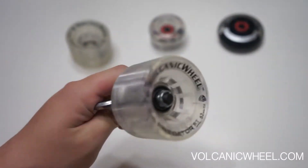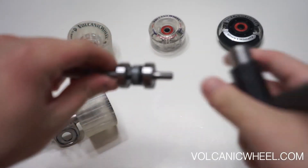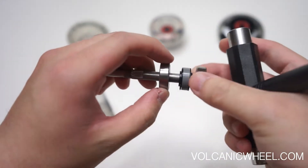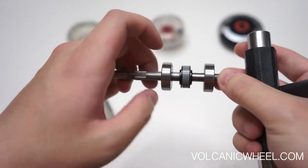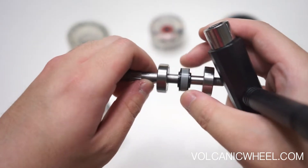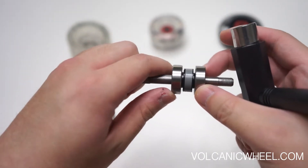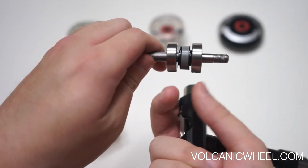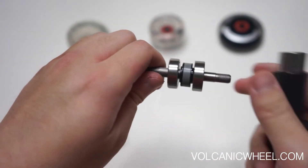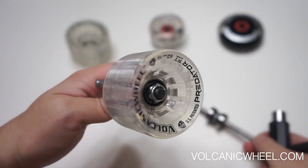But it's important to understand that it's because there's a gap between the outer bearings and the inner magnet. So when the wheel is spinning, this inner magnet should not be spinning. And that can be accomplished by making sure these two bearings are firmly holding the magnet together. And that's what we did by tightening the bolt here.